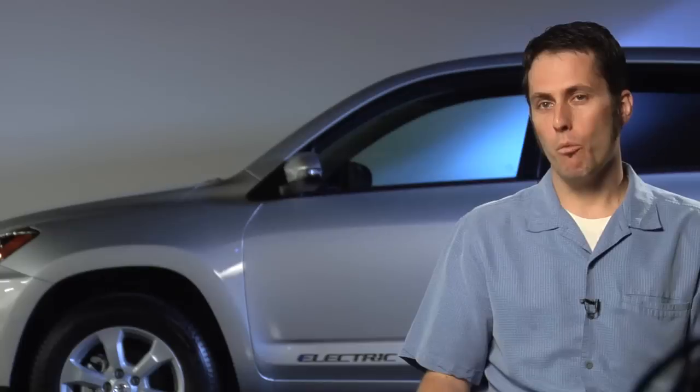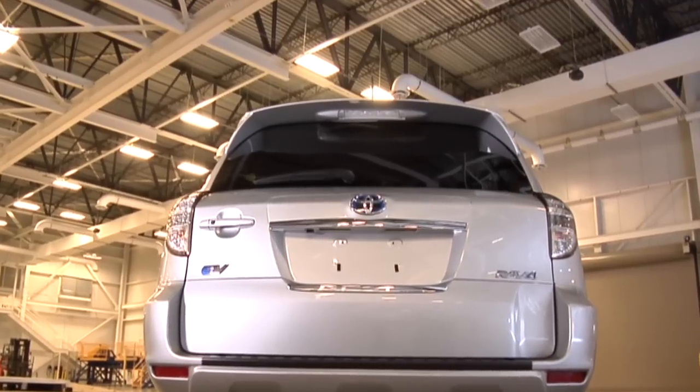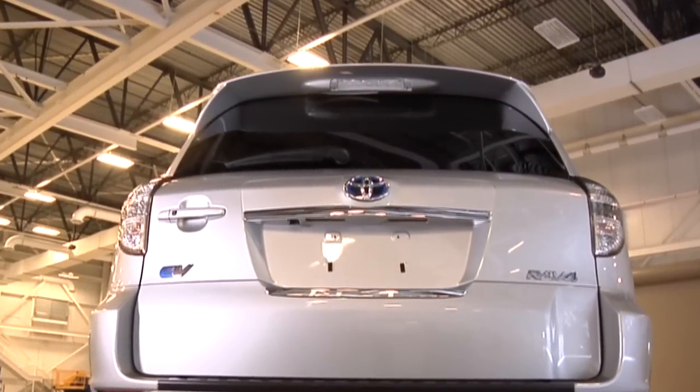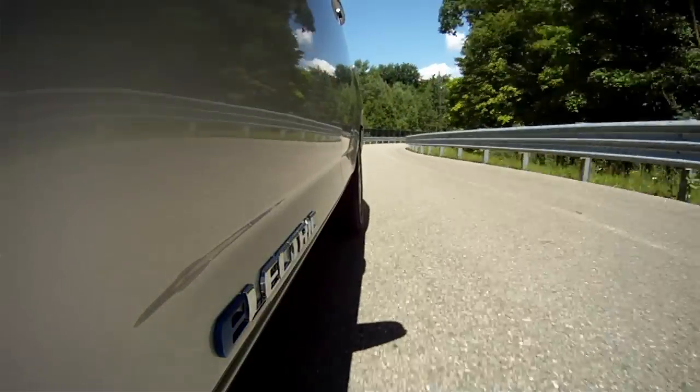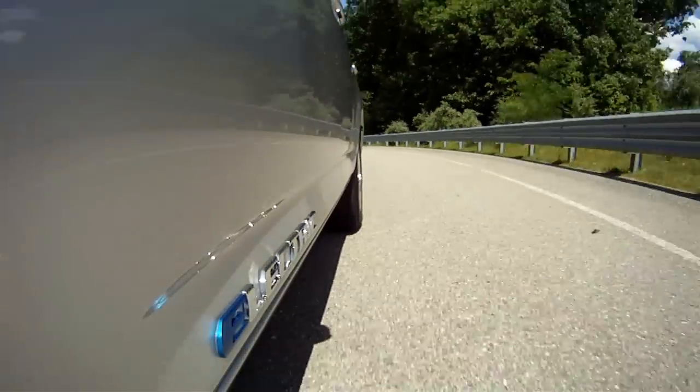The spoiler is one of the biggest single items on the vehicle for reducing drag as a point value for a single component. We did joint development in the wind tunnel with clay and arrived at a design that tapers the airflow off the roof and releases it smoothly from the vehicle, as well as tapering the airflow around the sides, helping with wake pressure quite a bit.